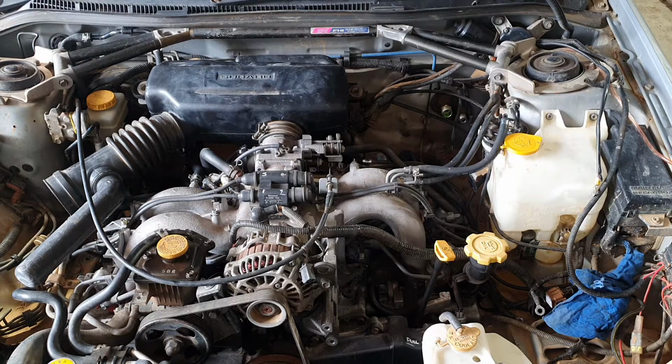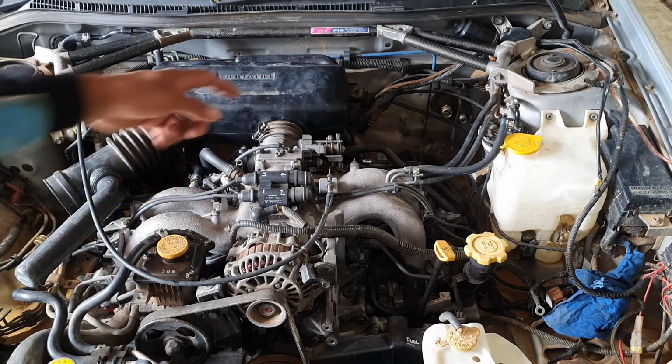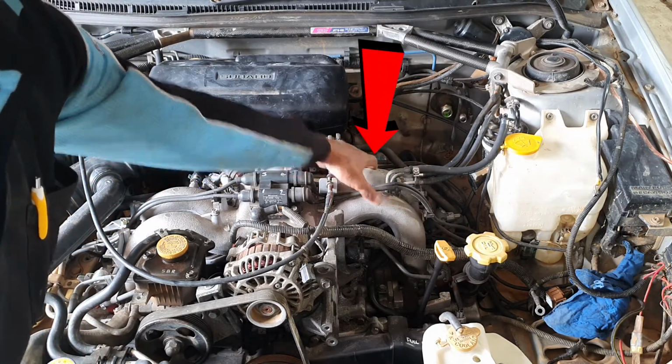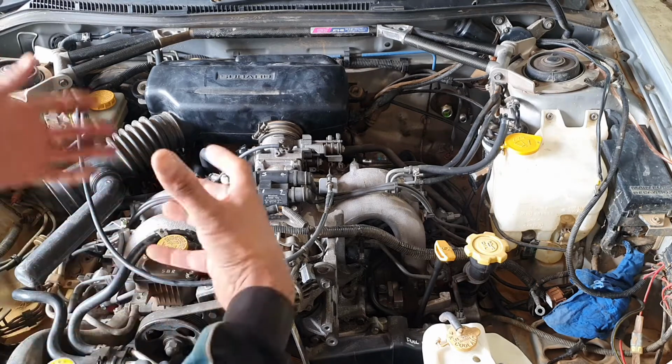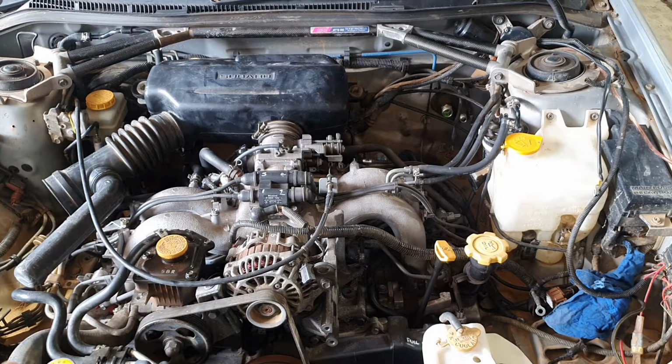The last sensor that is really critical to make this engine run is what's called a MAP sensor, or manifold absolute pressure. Now, in some cars like the WRX, they actually have an external MAP sensor. In this particular case, the MAP sensor is actually going to be on board the computer. So it's actually got a tiny little sensor that's built in on board the computer. What happens is we'll run a vacuum line from somewhere over here, probably off this port here, inside the car, plug that onto the computer as well. And using that, it works out whether there's vacuum or boost inside the manifold, and then it can calculate everything from there.